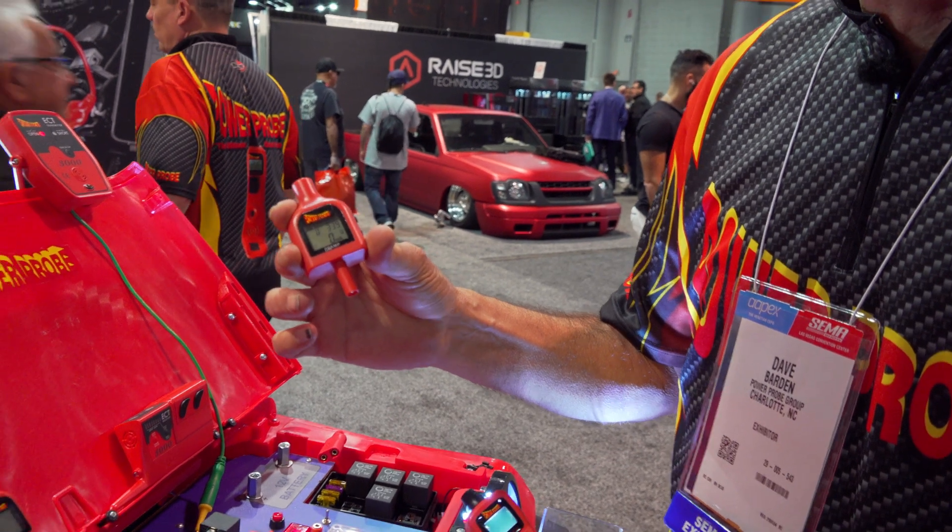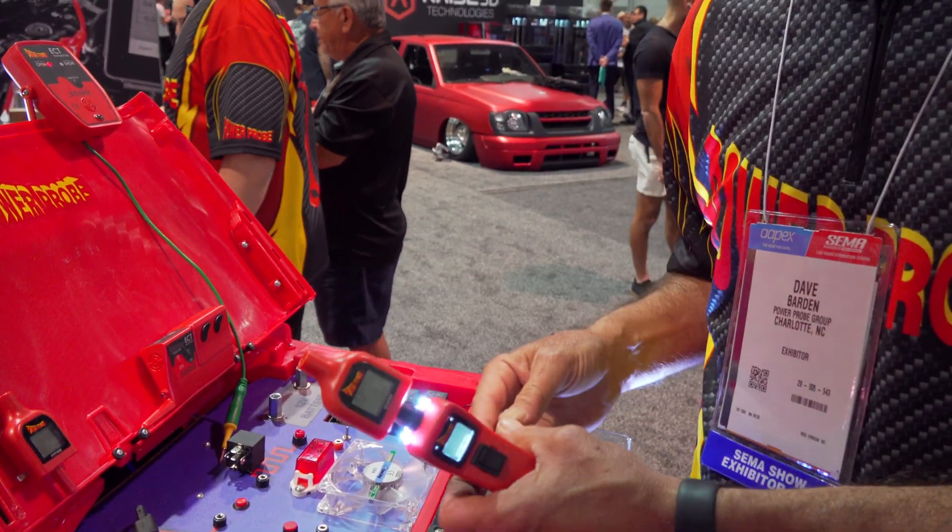But theoretically I could use this as a stand-alone tool. Like if I wanted to measure a battery parasitic drain, just wire it between the battery terminal and the cable. I don't necessarily need the Power Probe to use this tool. And because it's accurate down to 1 milliamp, it's really accurate on those low ranges.